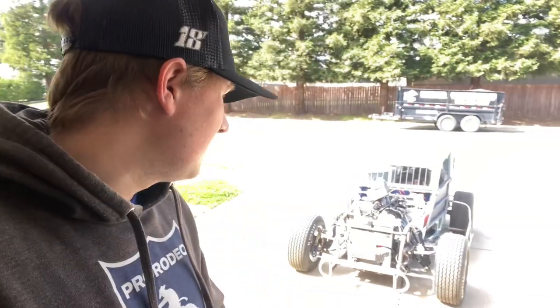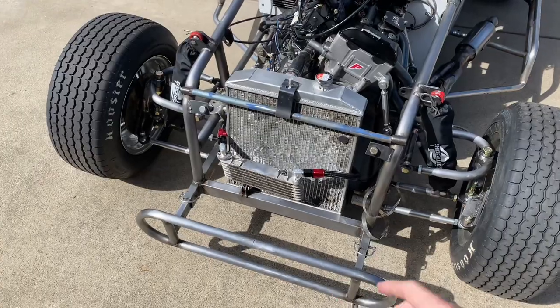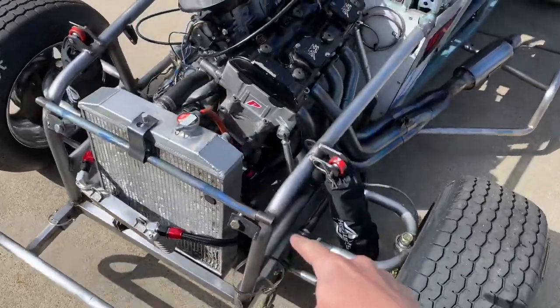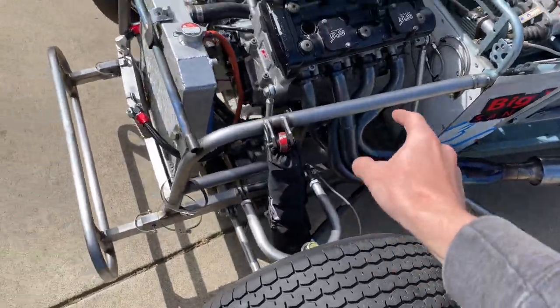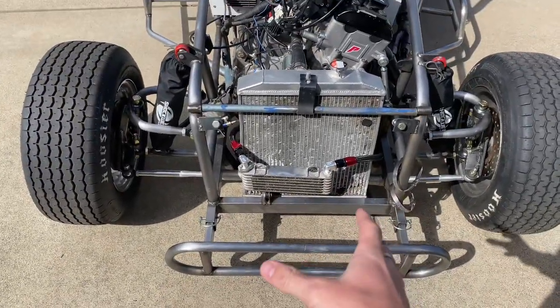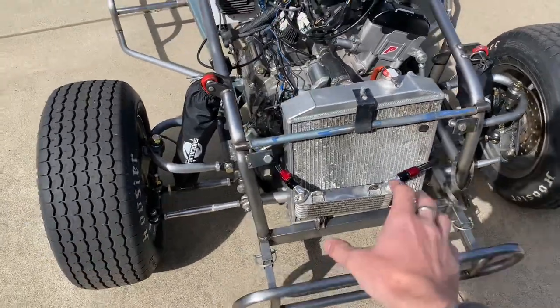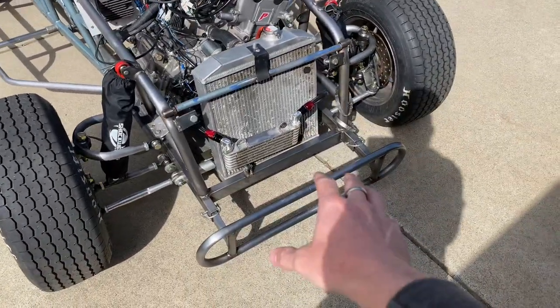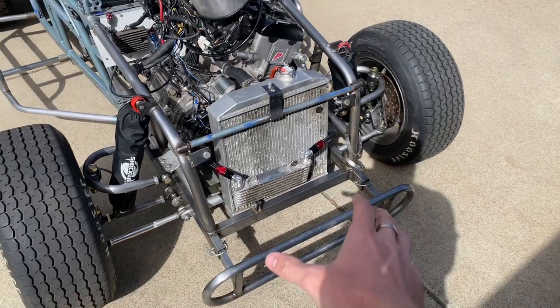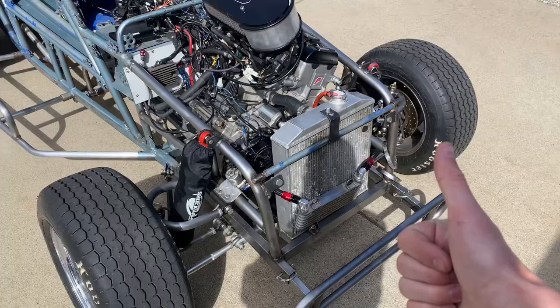Fingers crossed we're getting all this out of the way at the beginning of the year. Let me show you what we have done with the car. A couple things you might notice differently: I built oil lines now, and instead of running the oil cooler there, we're going to run the oil cooler in the front of the radiator so it's going to get the maximum amount of air and keep the oil cool — hopefully that helps our bearing overheating issue.